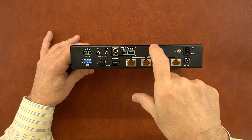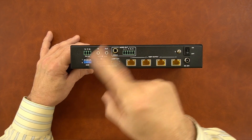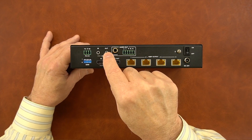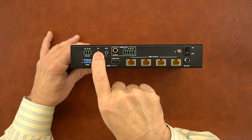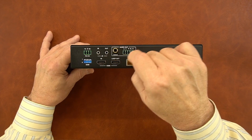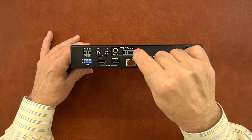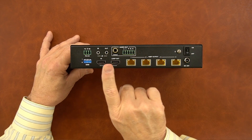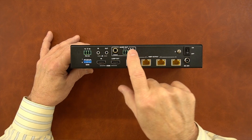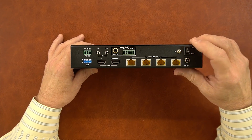On the top row, starting on the left, the unit can also transmit RS-232 signals, and you can use the connectors included with the kit to make that connection over the same network cable. To the right of that are two infrared blaster module connection ports — three and a half millimeter ports. You'll plug in one blaster here and the other one there, making sure you plug IR in and IR out into the correct ports. The unit also provides local audio extraction capabilities with coax or left and right connections available. That allows you to take the audio stripped from the HDMI media stream and send it to a local audio source for better quality audio. To the right of that is a ground stud to eliminate interference, and a power switch to turn the unit on and off.